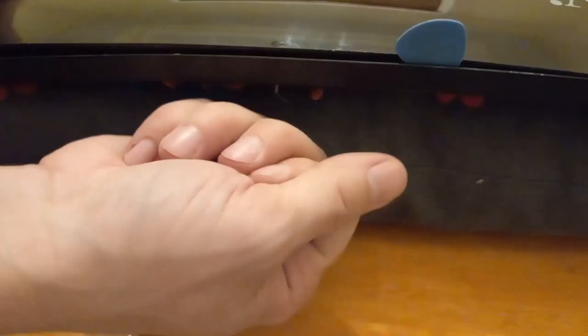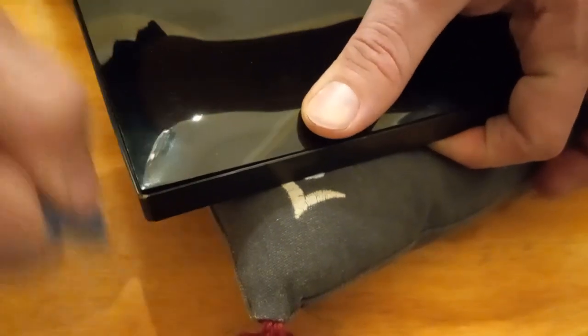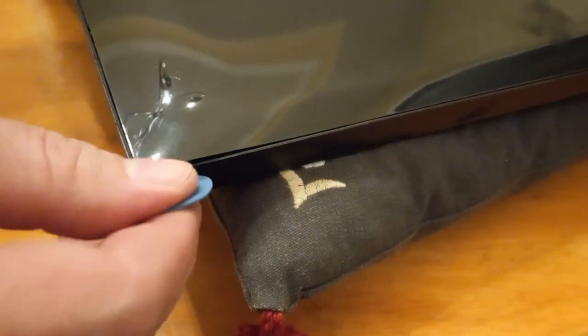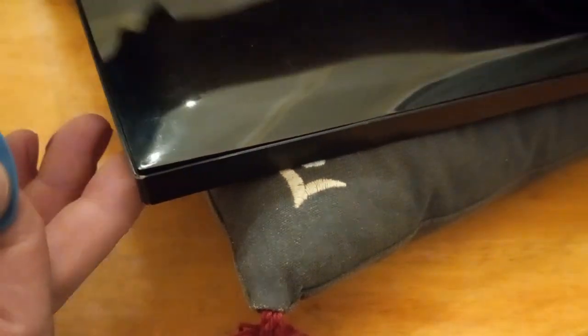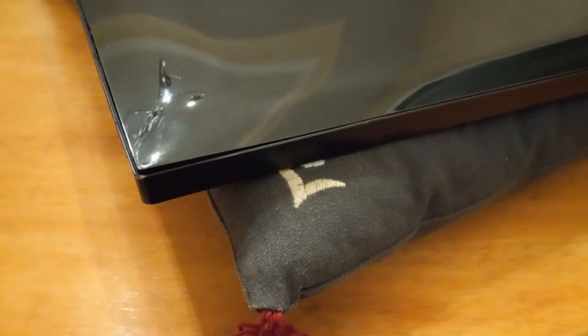You may need to angle the tool a bit. It's worth noting it may be easier to unzip the left and right sides before the top edge, depending on your model. On the far side, I like to wedge it open with a second tool, but that isn't always necessary. You can either turn the corner and go down, or start at the bottom of this side and unzip up toward the corner. Once you zip your way up to the corner, the whole thing can lift out.